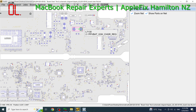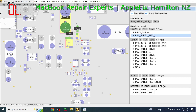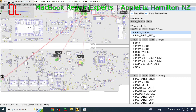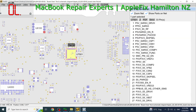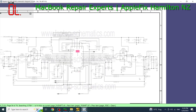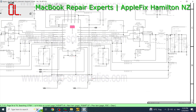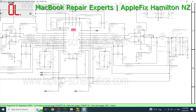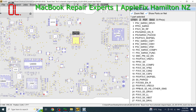We have got our G3 hot here which was present. The next thing — this rail is missing. This is the 3.3 and 5 volt section. I'll scroll down so you can see the 5 volt power supply. This is where we have to look first. That's U7501.